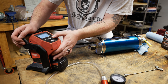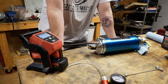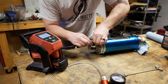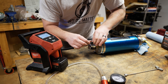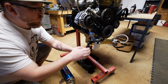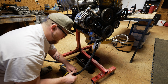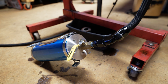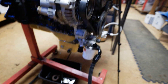So that's full now. Let's go to 40 PSI because we're going to lose a bunch when we take this thing off. Now I need to quickly get this off to lose as little air as possible. It dropped down to 30 PSI. So we got about 30 in the gauge — that's not bad. I'm going to run a little bit of a shorter line this time. We're going to hook the AccuSump back up, crack open the line again, and hopefully this time oil gets pushed up through the lifters in the head. I can hear it.